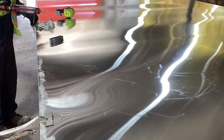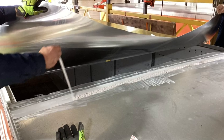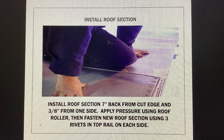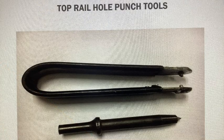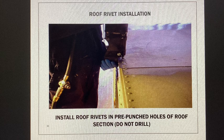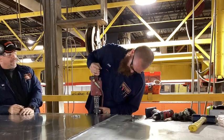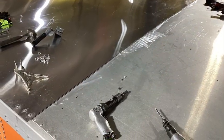Let's get that clamped down as well. Go to the rear of the trailer and secure our new roof material to our existing roof material. Please remember to apply Sikaflex to at least 3 inches on the left and right side of the top rail as well. With our roof section installed, fasten that new roof section using 3 rivets in the top rail on the left and right side. Now let's take a look at our top rail hole punch tools and hole finder. Use your hole finder tool and a hammer to mark the holes in the roof sheet so you can drill them out. We're drilling into the roof material into the top rail where the top rail has existing holes — we just don't want to drill new holes in addition to the holes already in the top rail. Here's what it looks like with the rivets installed.